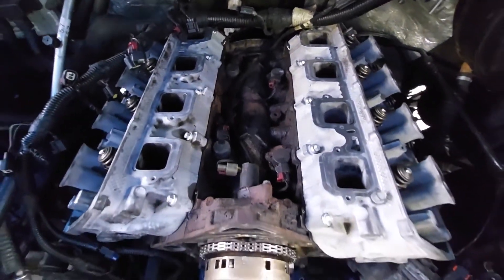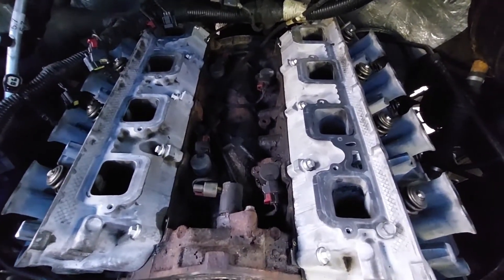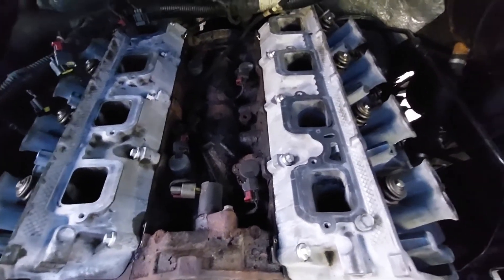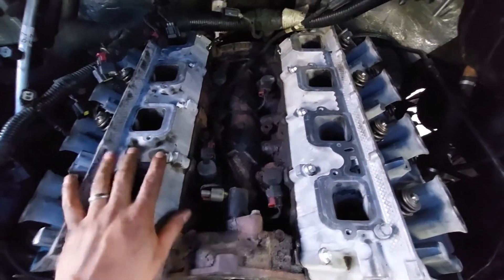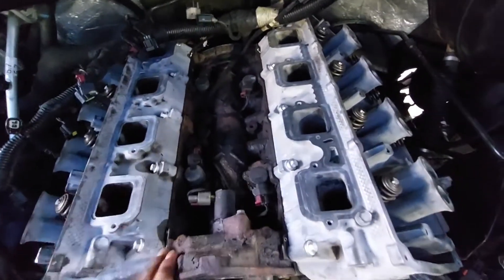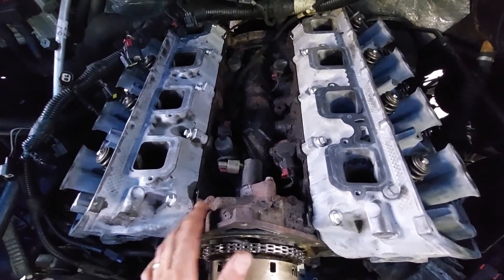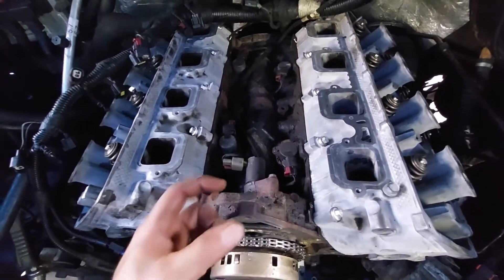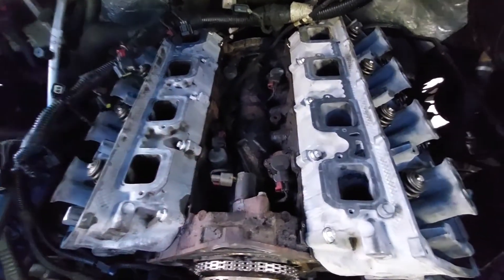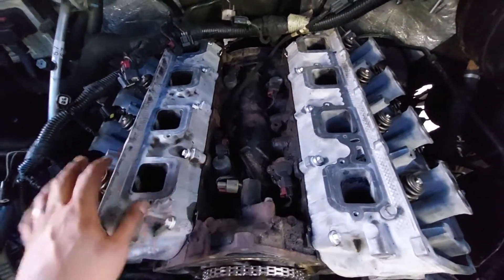I don't know exactly what will happen if the orientation is wrong, but everything says severe engine damage will occur — though it probably just triggers a service engine light. Once you have that all installed, make sure your gasket surfaces on both the block and cylinder heads are nice and clean. These are aluminum heads, so you don't want to use anything aggressive. I like to use 3M Scotch-Brite on a little disc — they make a special 3M pad for aluminum that looks like a cup with fingers. It removes all the old gasket material. Then wipe down your cylinders of all dirt and debris.